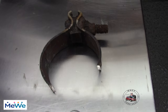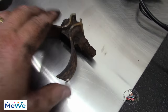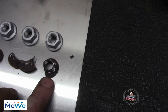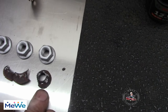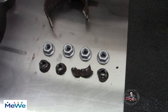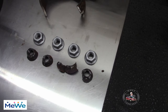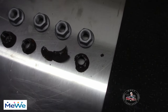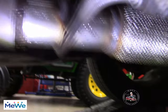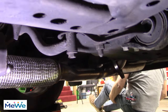I ended up using a cutoff blade and cut that bracket off. For the nuts — I used a chisel on this one and a chisel on this one, but the nut extractors worked for the others. I got one partially chiseled and then used the nut extractor; the last one I chiseled all the way off and pulled it off with channel locks. We heated them up and tried to break them free but there just wasn't enough meat left on the nuts. Got the new clamp on, got it seated in, hangers on — now we're going to mount the bolts and the gasket and get it all tightened up.